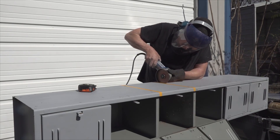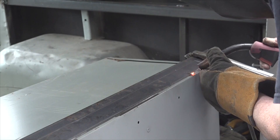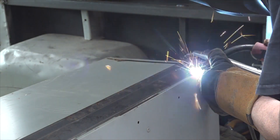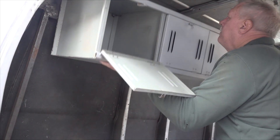Now if this was the exterior finish on an automobile you would continue sanding with a lighter grit sandpaper, use some Bondo to fill in any small dents or scratches, do a final sanding, then prime it, sand it, and paint it. But since it's just going to be overhead cabinets in the van, I'm sanding it with 120 grit sandpaper and then I'm going to prime any areas where you can see metal through the paint to protect that surface until we can paint it with the final color. After that I welded the brackets designed to support our overhead cabinet on both the cabinet and the upper wall, and I welded a rear brace in to level and attach the cabinet to the van wall.